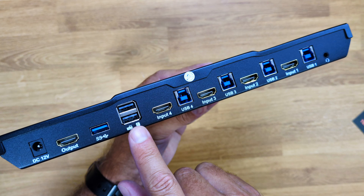How do we connect the KVM? It's really simple. Where it says input 1 or input 2, we connect computer 1 to those ports — one HDMI cable from the computer and one USB cable from the computer to the KVM. That's it — just two cables per computer. We then repeat the process for all four computers or consoles. We can also connect other devices besides computers and consoles, but that's a choice we will need to make.